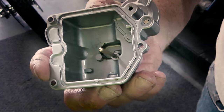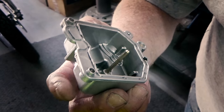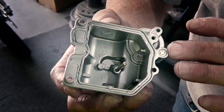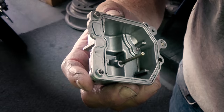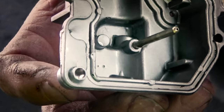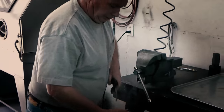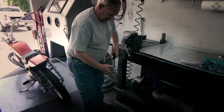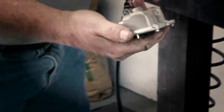I have finished blasting it. What you do want to do after you're finished blasting is you always want to dip your part in water. On a carburetor body that has all the little passageways, you can blast through those — not a problem — but after you've dipped it, you do want to blow any media out of those passageways. You just take compressed air, and especially on this float bowl you've got your overflow tube — you want to make sure that's clear.